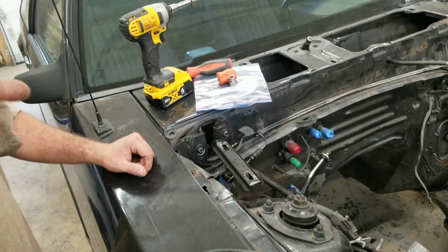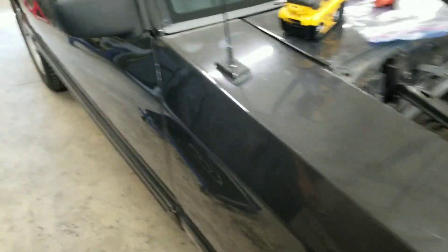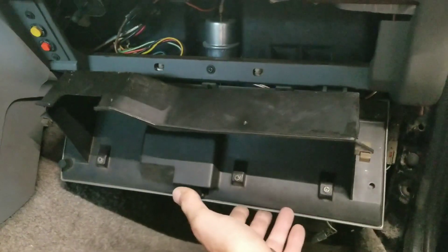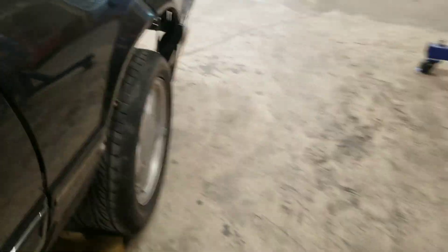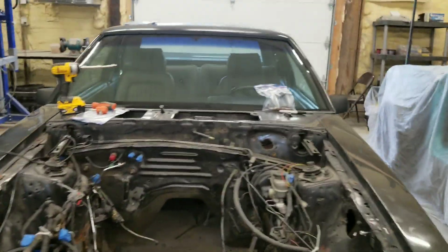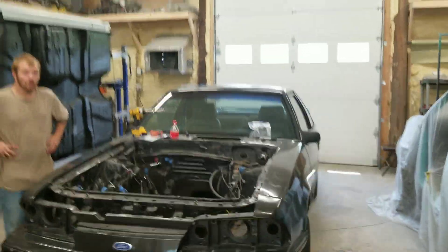One more thing — in order to pull the front end off as a full piece, you've got to fish the antenna wire through the firewall. I unhooked it from the stereo and pulled it through the little bend in here. You've got to take that kick panel out and all that stuff. Then the last bolts were these here — after you remove the ground effects you can get access to them. If you guys have fog lights and headlights and stuff, you'll have to remove that too, but it was already removed on this one.